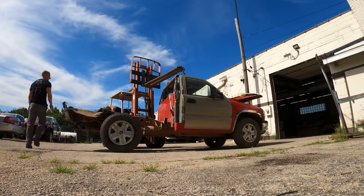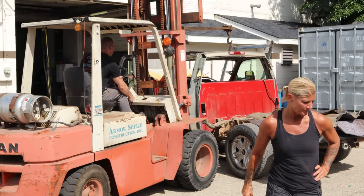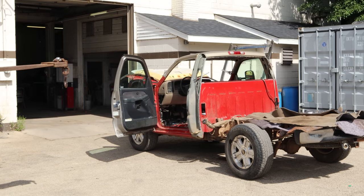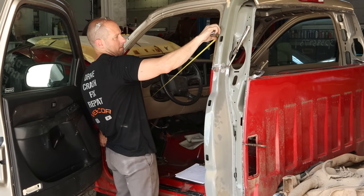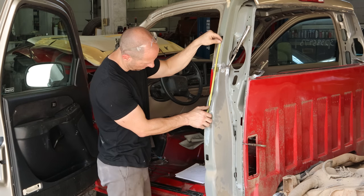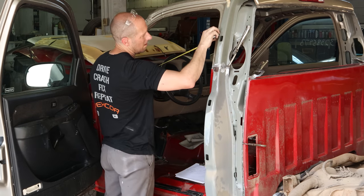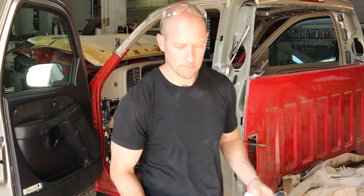Now we're switching jobs again — pizza girl is not licensed to drive the forklift, only operate the levers. We'll pull it inside and continue working on it. We did this all outside because I didn't know if the roof of the shop was tall enough. The driver's door closed so things might be in the right place, but there's only one way to be sure — let's measure it. So we're going to measure all of our dimples. We use cross measurements, side to side and up and down, to make sure everything is where it's supposed to be. If our door gaps are right, everything should fit.